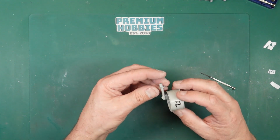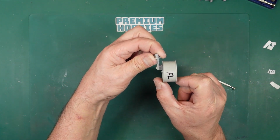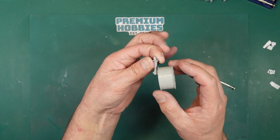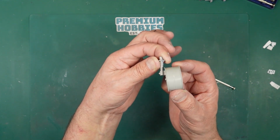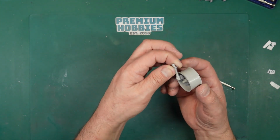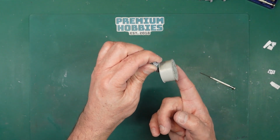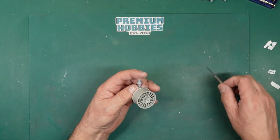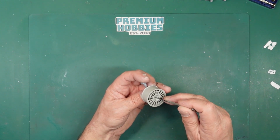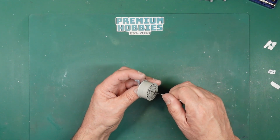But you can see here, if I hold the strut solid, we can see that the wheel has got, let's get rid of that FL, it's distracting you. The wheel has got, look at that, it's a joke. So basically when you put your car down, the wheel's going to want to do that, and you're going to have loads of negative camber. So if you want to tighten that up, there's a couple of ways you can do it. The problem being is in the design.